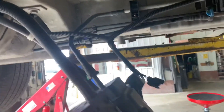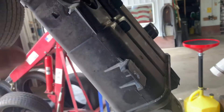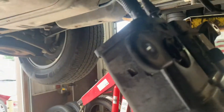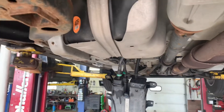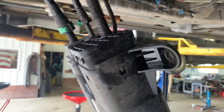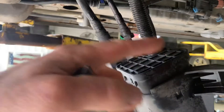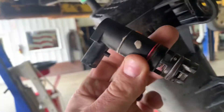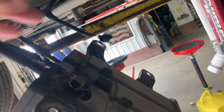So here's the deal — this is the evaporative emission system canister, charcoal canister, whatever you want to call it. A lot of people just call it the canister. The fuel tank on this vehicle is hiding right here; it's tiny on this Equinox. These are the vent lines to this. You have to have venting working out of this canister and out of this tank. When you fill it, the fuel comes in, air comes out through this vent and through this valve, which in this case is placed right in the top of it, and it's got an electrical connection which goes up to your engine computer.